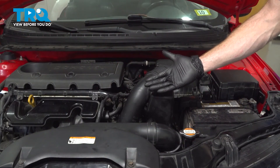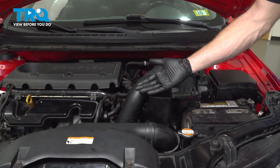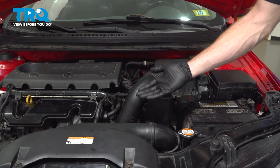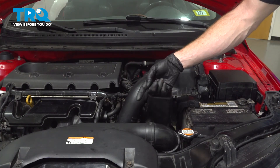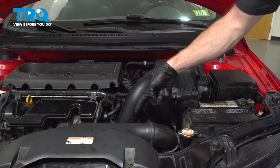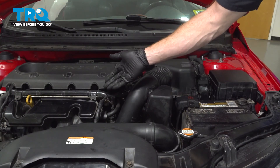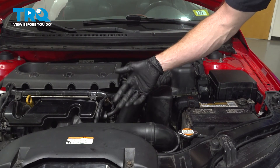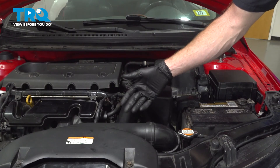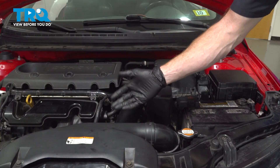We finished our installation. The next thing you need to do is attempt to start up the vehicle. What you may find is a long crank scenario — it's going to crank a couple times before it actually starts up, due to the fact we have to build up fuel pressure all the way up to the fuel rail across the front of the engine. Once you have pressure there, the engine's going to fire up and continue running. After that, make sure you have no fuel leaks, no check engine light, no running condition issues, and take your vehicle for a road test.